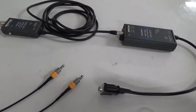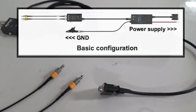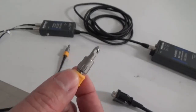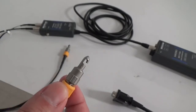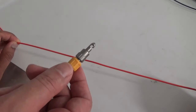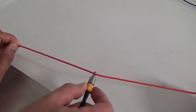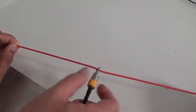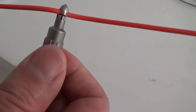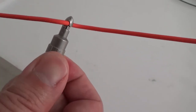With this CAN sensor, however, you can easily monitor the signal without processing the CAN bus. If you turn the yellow part of the probe open, the hook opens up. Attach this hook onto the CAN bus. By turning it clockwise, you can pinch the sensor securely onto the cable. It will stop spinning when the probe hits the cable. You can't damage the cable by turning it too tight, so make sure you turn it firmly until it stops.